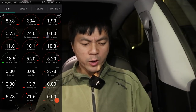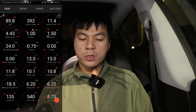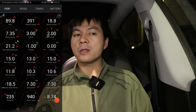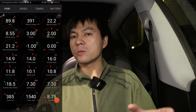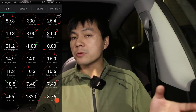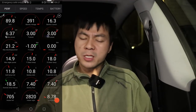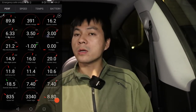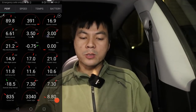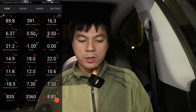I had to wait a minute, then preheated again. The afterburners start firing up. We are plugged in and the charge limit was set to 95%. This case is different from the first Fortum case because here I only had about 5 or 6 kilowatt available from the plug instead of 11. So the car is pulling power from the battery — the battery is being discharged. It prioritizes firing up the afterburners this time.